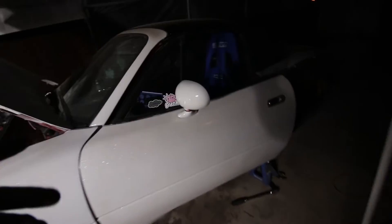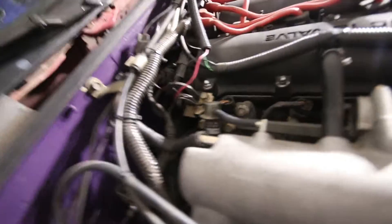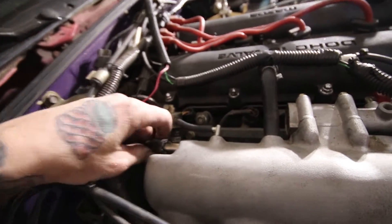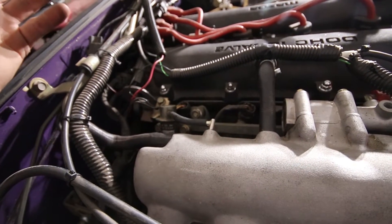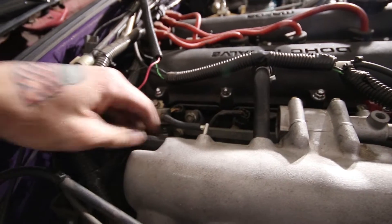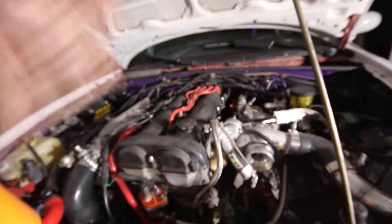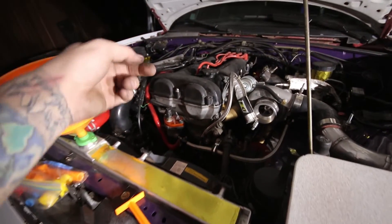I had to run and get coolant and brake rotors, which gave me time to look things over. I was checking the TPS on the computer and everything looks good. I was spraying around for vacuum leaks and noticed this vacuum line right here was off. I think when we were rocking the engine back and forth earlier, it came undone. I'm going to throw a hose clamp on that just to be safe — it's not like it can go anywhere once it's in there, but better safe. That should be the source of the rough idle, so it should idle normally now and I can bleed the system.